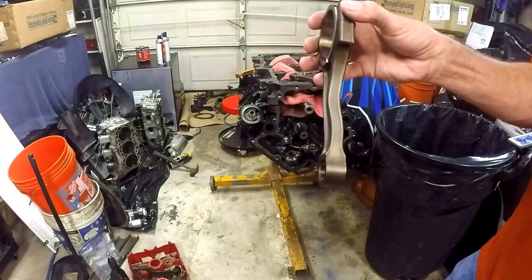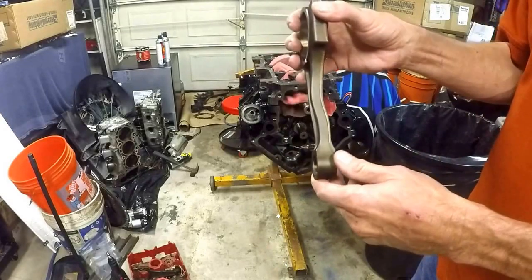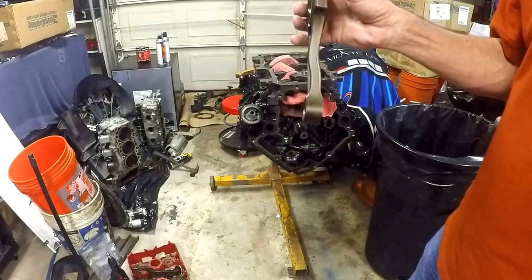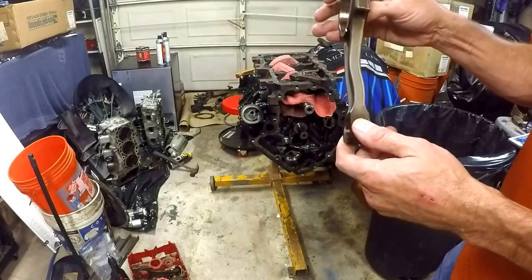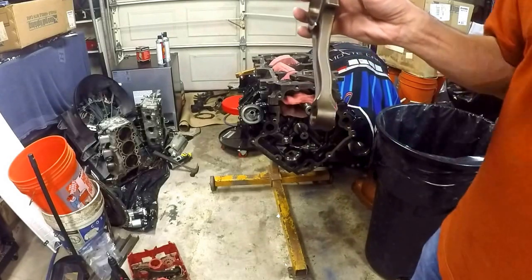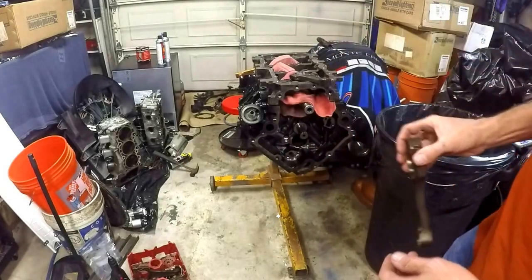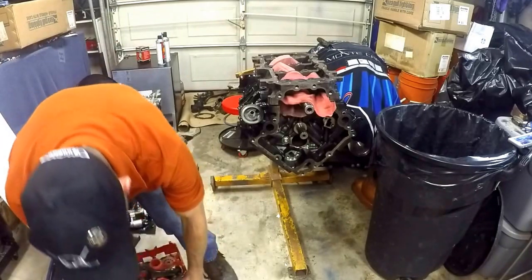I'm beginning to think this motor was previously rebuilt and they missed this, or didn't care enough to get a new rod. I'm also beginning to think that whatever caused this event — maybe they dropped a valve seat on one of the cylinders — it hit this piston and caused this rod to bend. They rebuilt the heads but may not have replaced that valve, which may have become weakened because of an impact. I'm really beginning to think what we're dealing with here is a result of bad history not being fully resolved on rebuild, translating into the problem we're seeing today. The rod that was destroyed has to be replaced, and this bent rod as well has to be replaced, so I do have two rods coming. It's a very interesting sequence of failures, and I don't believe at all that they're coincidental.